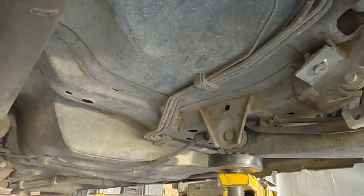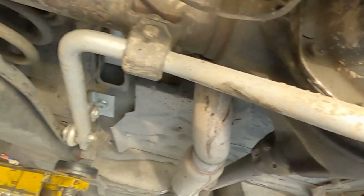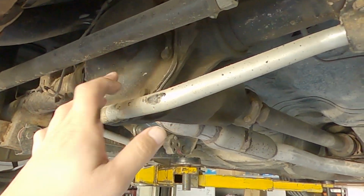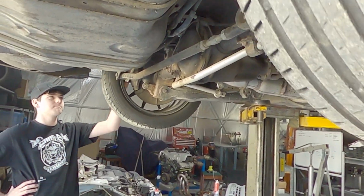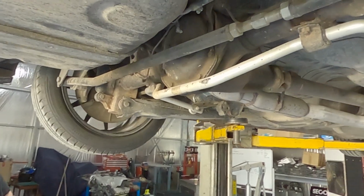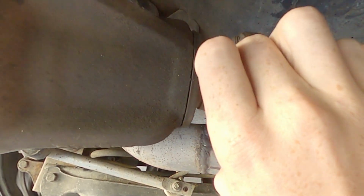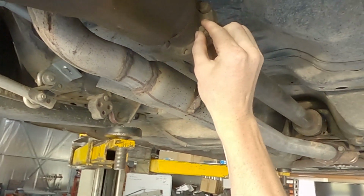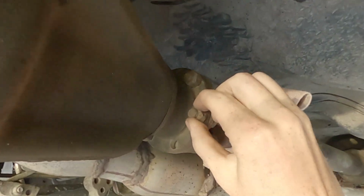So that's the rear end. It's not overly complicated. And then solid rear axle. And this has had 3.9 gears in the back with a mini spool. So you can see when the wheels turn, they're connected. There's no slip, no limited slip. Oh. Alright, so they're loose. Oh, that is loose. Alright, so this is what we're here to do. We're just having a good look under the car, getting it ready for the first track day.